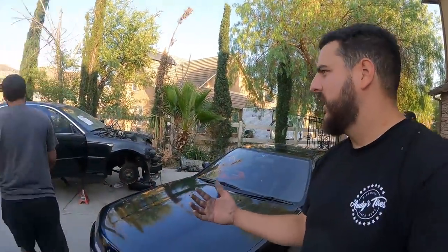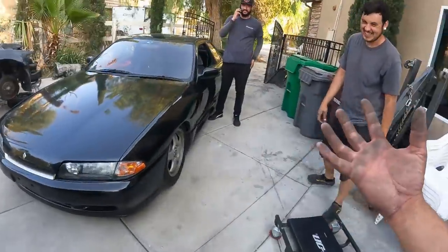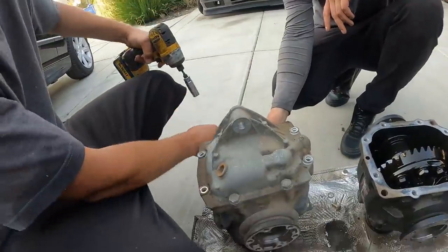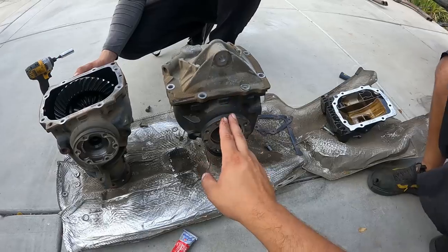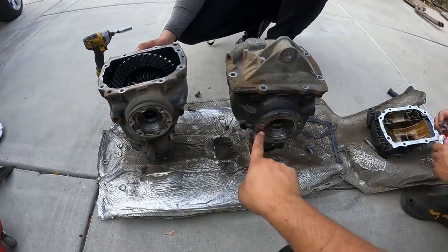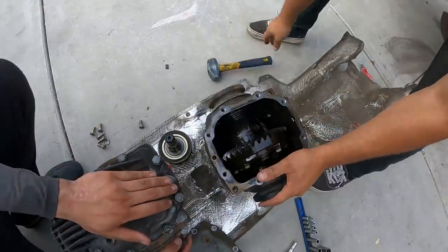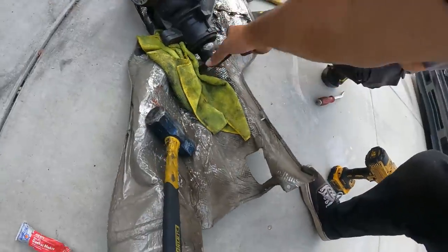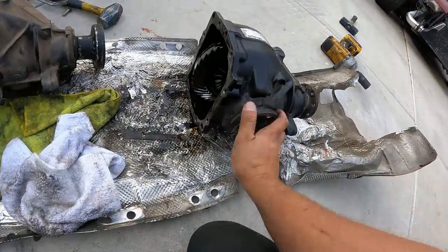So we got the freeway flyers — now we need some street smashers, which is a 3.46 to 3.49 ratio. That changes things a bit, but everything's going to help especially with this low power. We're swapping diff covers because he has a ZHP. This is a 3.46 — we're swapping a bunch of parts around. I want to weld this thing and then it'll have a 3.49 in it. We've got to swap the output flanges, swap the back covers, and then swap the input flanges because his is a six-bolt and mine's a four-bolt. If only we knew somebody with a MIG welder.